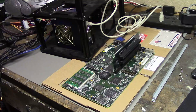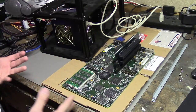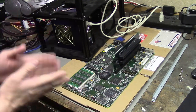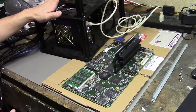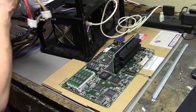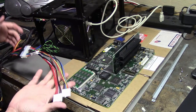It's been some time later and I've cleaned the motherboard, the case, and tried to clean the power supply. Visually the motherboard looks clean and perfectly fine — I see nothing wrong with it. So I figure, might as well try to plug it in and power it on on its own. I'm not going to use the power supply that came with it just yet — I'm using a known good ATX power supply with an ATX-to-AT adapter, and we're just going to see what happens.